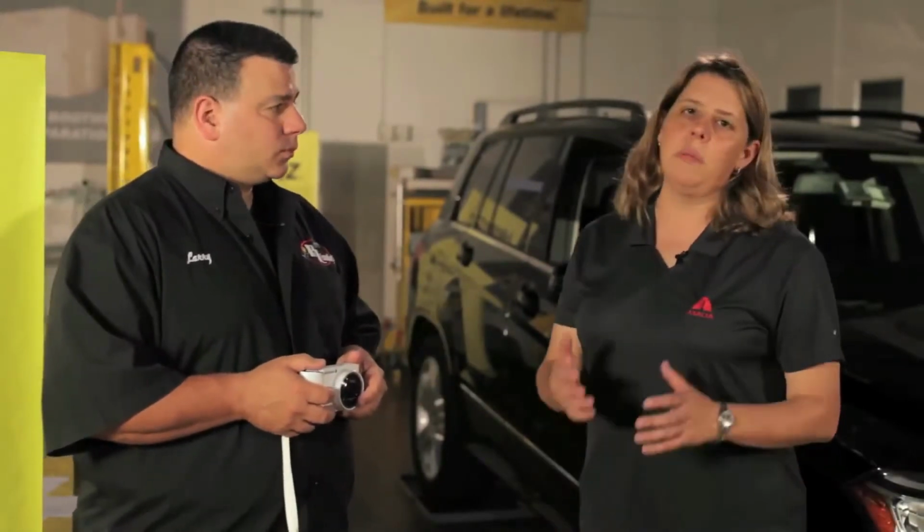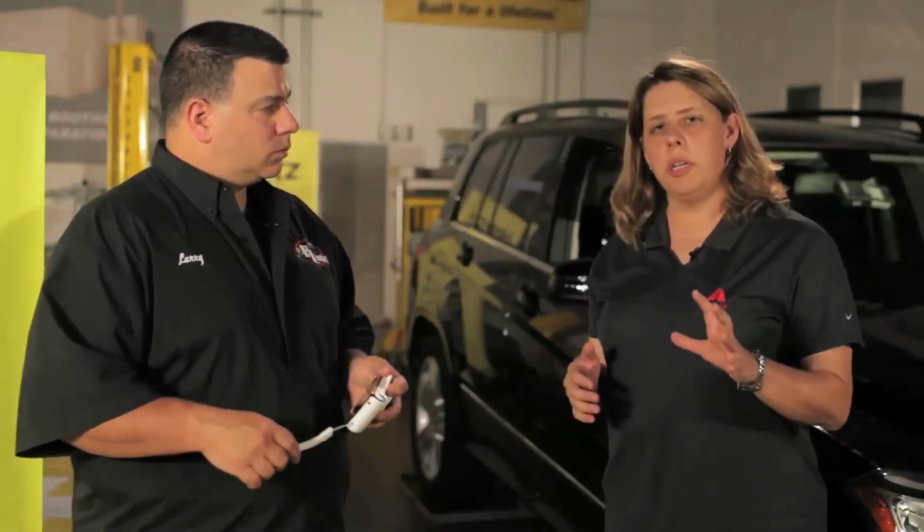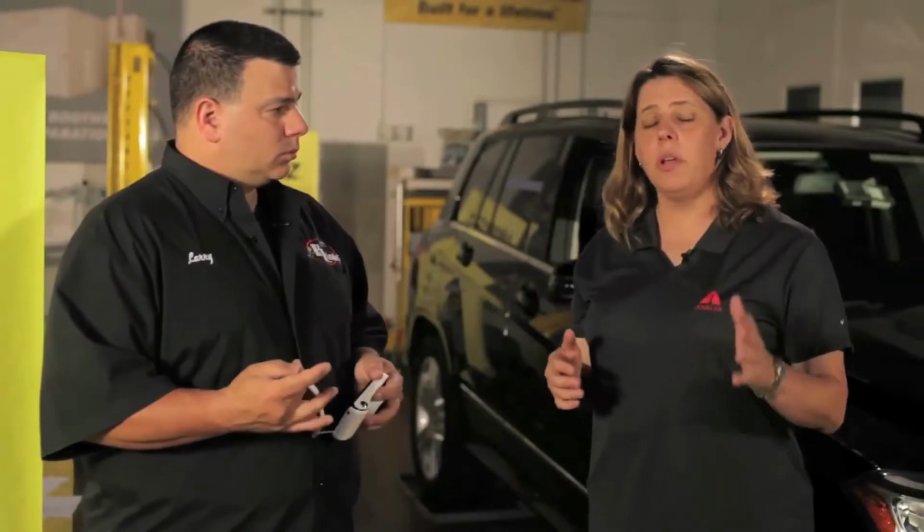Right. Now, one of the things to keep in mind when we talk about light is a lot of times the flash is always going to overexpose your picture, and that really happens when I see shops trying to take pictures within the engine compartment or around the suspension or in the undercarriage of the car. We feel like it's so dark in there already, the flash turns on, and I just get this bright burst of flash under the car, and the camera kind of forgets what it's supposed to be taking a picture of. Having a handheld light or a secondary light source under the car with you to take those pictures, even if you're outside in the sunlight, can make a big difference in the pictures that you're taking and the overall quality.